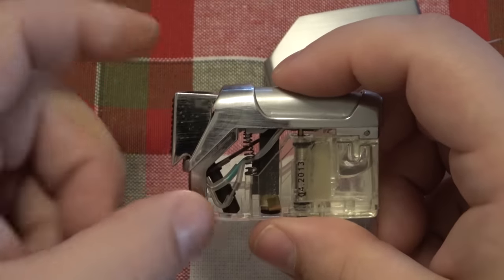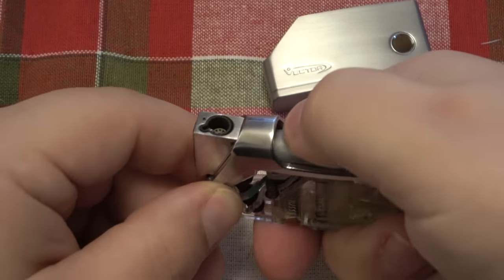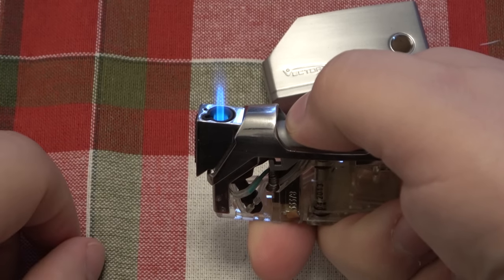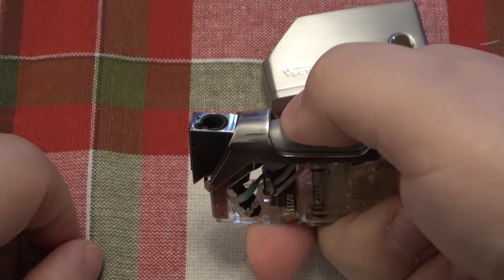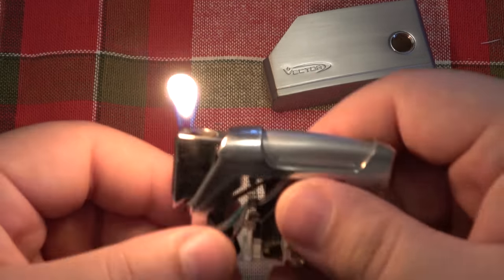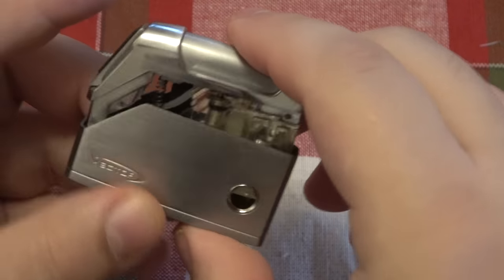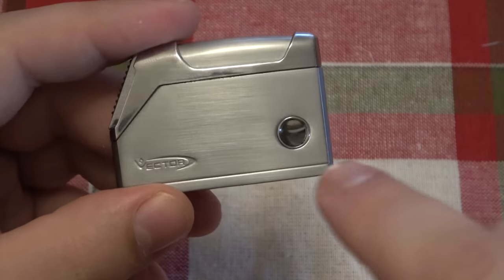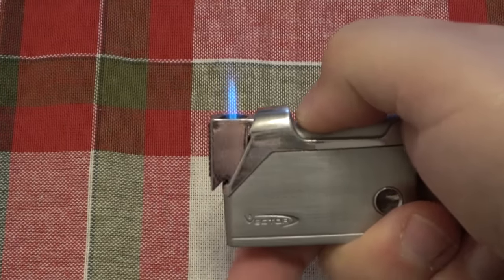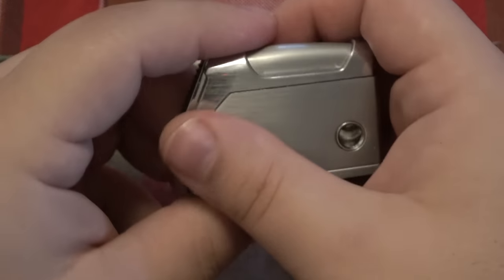Now we're good. If you didn't see the first video, the little button pushes the part open and once it does, it's already leaking fuel — that's for the short soft flame. I don't have a hundred percent light rate on this — there we go. We have our butane torch flame, and when you let go, you have your soft flame. I set it a little bit lower to conserve fuel; it does light more often. When it was a little higher, the soft flame was really big which I didn't prefer. Long story short, it is fixed, and I did not have to pay the $12 to fix that. You can see the little view window and where the fuel line is. Let's try it again with the case on — there we go, torch flame and soft flame. This one is back in business.